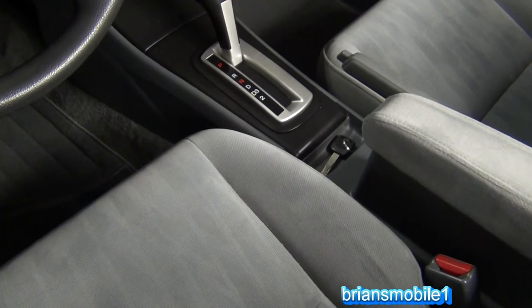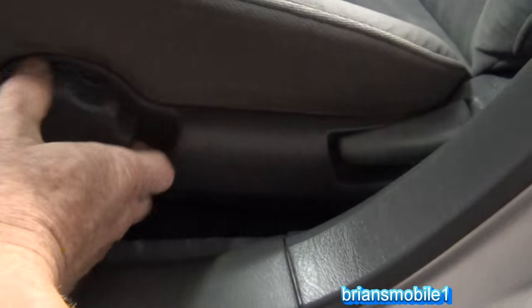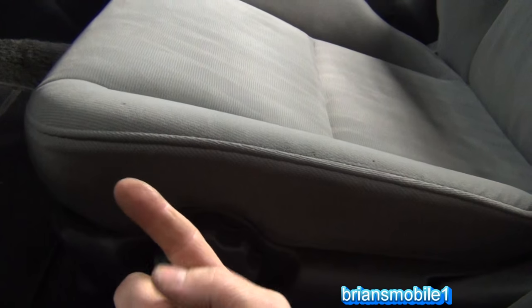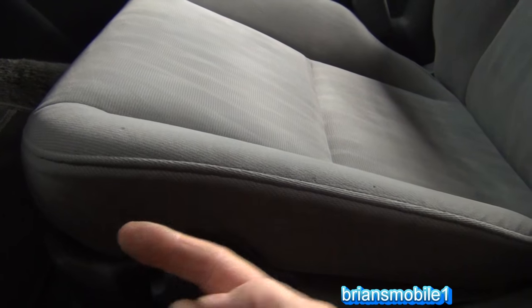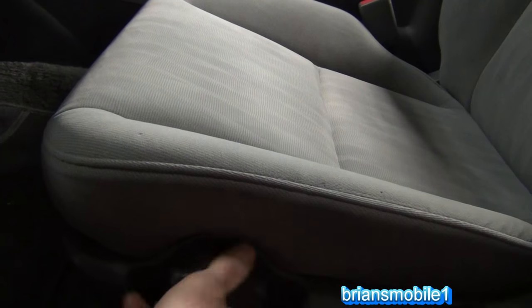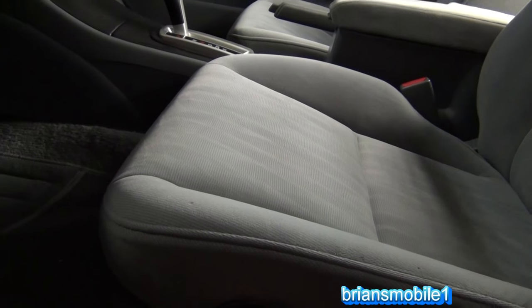Move it back and forth — you can see it's not secure, and the movement translates through the whole thing. This is on the height-adjustable ones that have a dial to make the seat go up or down. So this is on a four-link, meaning there's a bar with a pivot on each end — here, here, here, and here — so it keeps it parallel but moves it forward and up or back down when you adjust it.